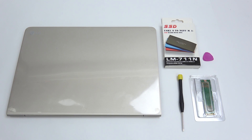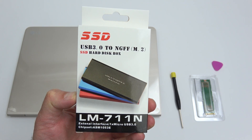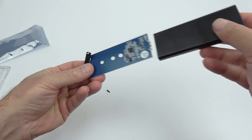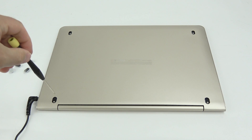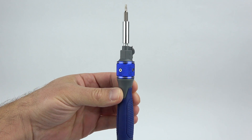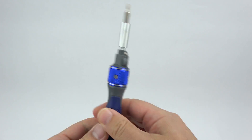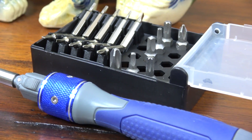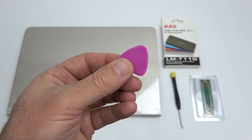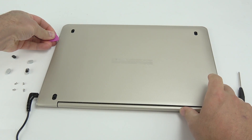Let's get started with the upgrade. Here's everything you'll need to upgrade your SSD and mirror your old drive to your new bigger drive. The first thing is the M.2 SSD to USB 3.0 adapter slash enclosure — this is just used to clone your drive. If you have a fresh version of Windows you'd like to install, you'll just need a thumb drive or CD instead. Next I have a small Phillips screwdriver, which is necessary for the LG Gram to remove the back plate — just pull off the rubber feet and the screws are underneath. A lot of laptops use Torx drivers like this one; this is a ratchet and double drive which turns twice as fast. It comes with a bunch of bits including multiple sizes of the Torx head bit. For mini laptops and especially the LG Gram, you want a plastic pry-off tool — this one comes from an iPhone screen repair kit, and I'll leave a link to it in the description.